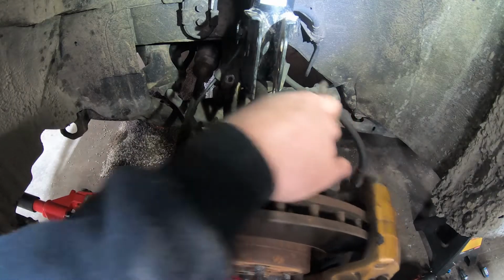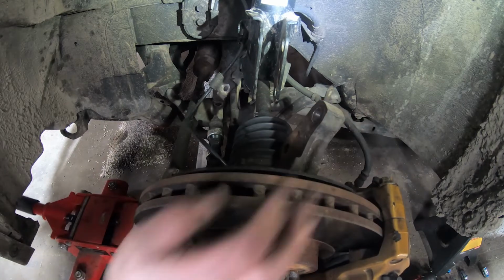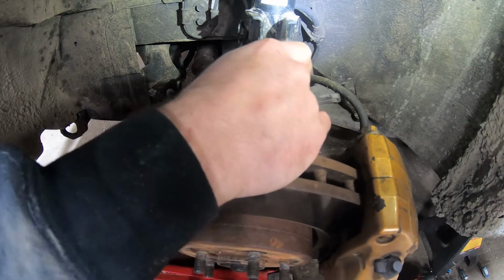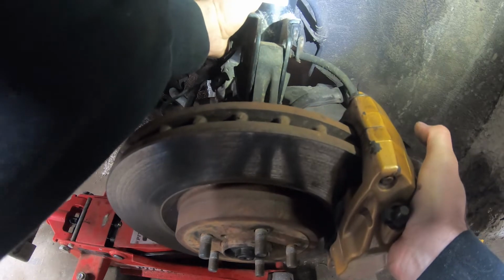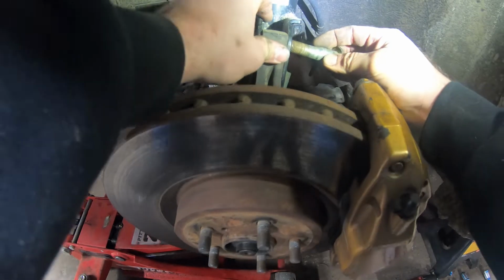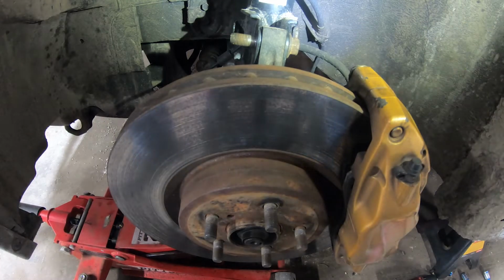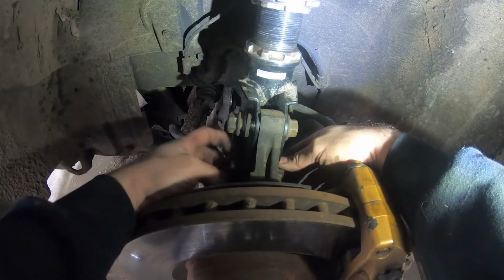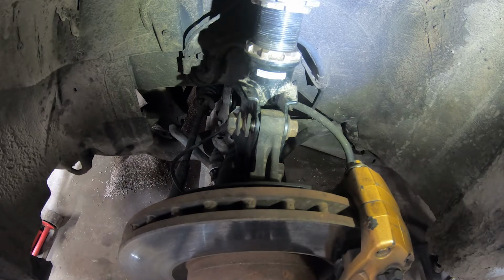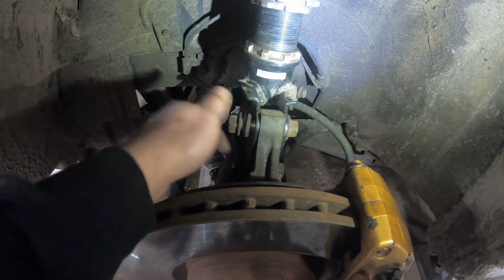All right, in order to get this to line back up, we're gonna have to just throw a jack on the bottom there. The top one's for the camber, so the bolt's a little different. Throw the bottom one in. Top one's gonna get the washer. This one on there, then it's just the reverse order that we did before. These bottom bolts right here are gonna get torqued down to 129.